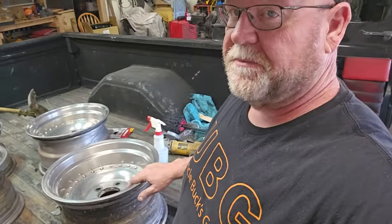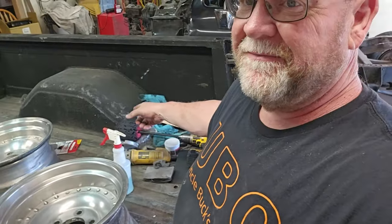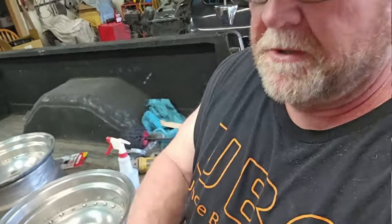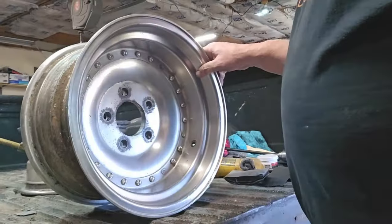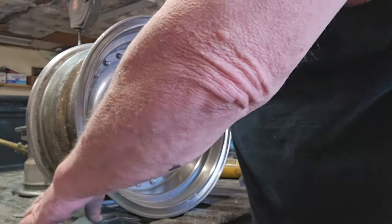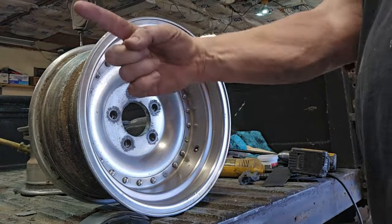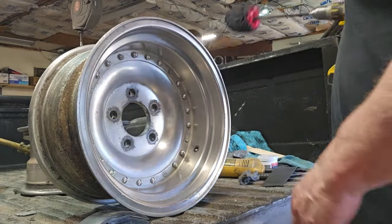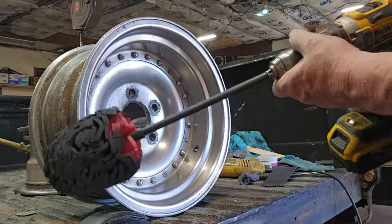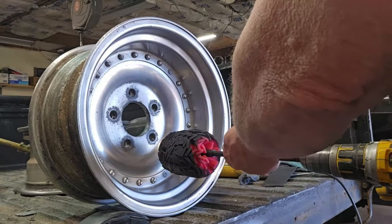The last thing is to put the speed to it and just give it the last hit, because that ball is already full of polish. All right, so you just got to use something to chalk it, because the speed on this is going to be pretty high, so it's going to try to push this wheel this way. So we're going to put it on number two and give it the final hit.